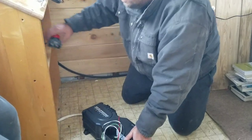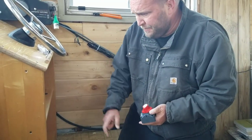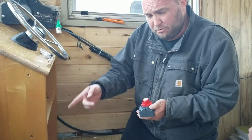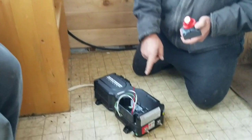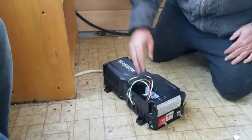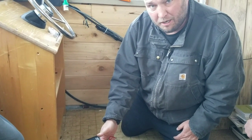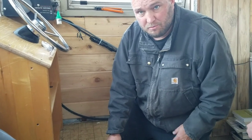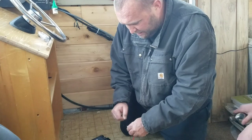Next, we're going to wire in our switch. We do have a 200-amp fuse set up down here. So we go from the battery bank to our 200-amp fuse, from the fuse block to the switch, and then from there it's going to go to the inverter, which we're going to mount right on the backside of this wall. And then before we kick this on, we'll have to wire in some AC wiring — just two outlet boxes in here, and we're good. From there we'll kick on the power and we'll have some juice.